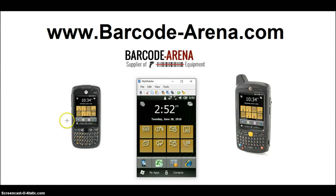Both of these handhelds run a specific version of Windows Embedded Handheld 6.5.3 Professional. The reason it's specific is because these devices are unique in that they have a dual-band WAN cellular radio where you can log in to the device and toggle it between CDMA cellular carriers like Sprint and Verizon, and toggle it back over to GSM, which covers global carriers like AT&T, Telcel in Mexico, and anywhere around the globe outside the US.